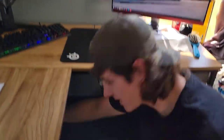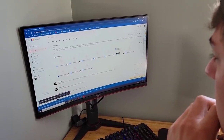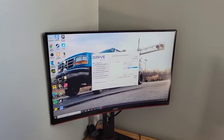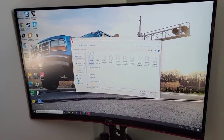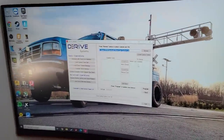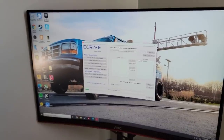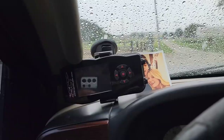Alright, so we've got the custom tunes here. We've got our SCT X4 plugged in. Look at all these tunes we got from Blast Performance. What you have to do is go here, click download on each tune — load custom tune file. You need to delete the old ones, then click 'Browse Downloads' and you'll have all the tunes right there. You do one at a time — add to device, program — and she programs right up. We'll do that for the rest of them and then get back to putting them on the truck.